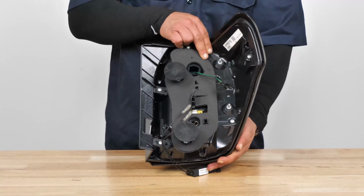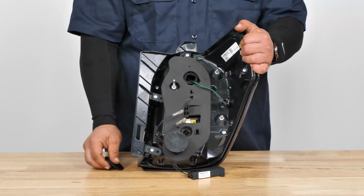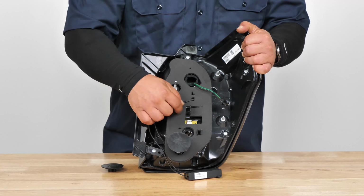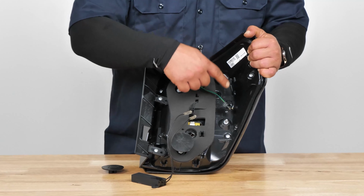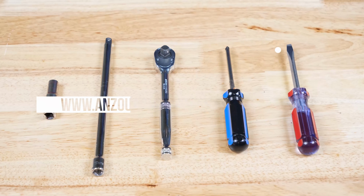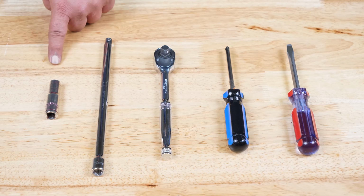And then on the back side, it is shipped with these covers on the screws. These, you'll just twist them and take them off. Then we have our connector for our running light, and the stock connections to transfer over the stock components from the light, as well as a resistor. And we have body locator pins here and here, and a foam gasket. Tools needed are a flathead screwdriver, a Phillips screwdriver, a 3/8 ratchet, a 3/8 extension, and a 10 millimeter.